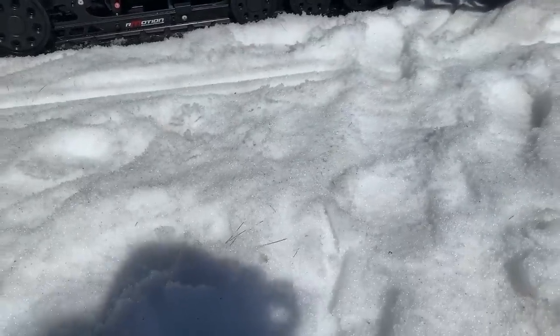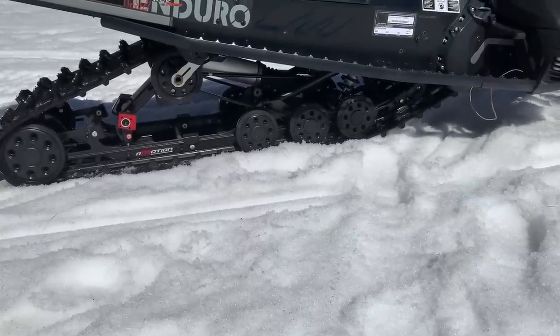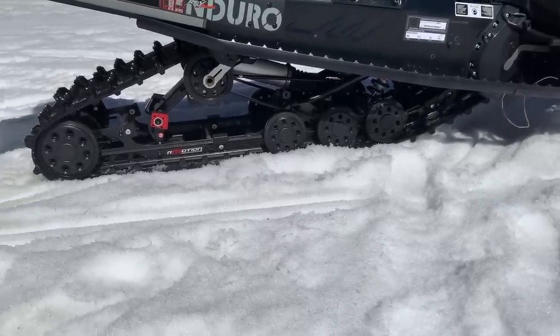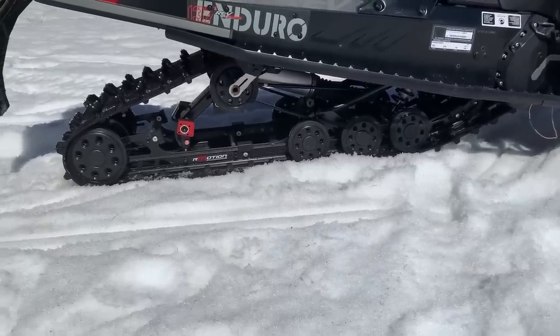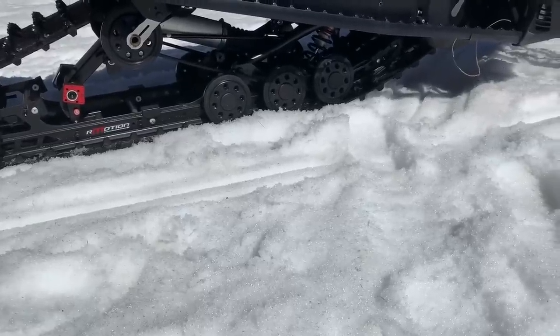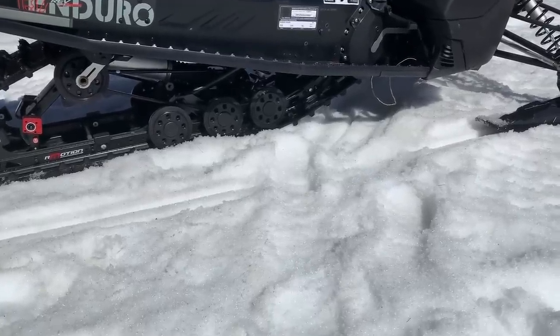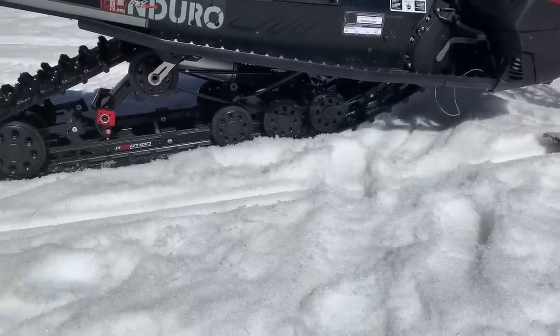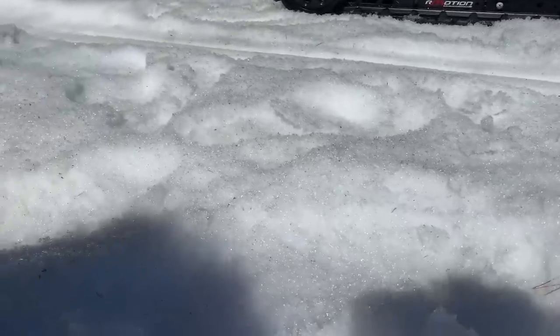We went out for a big ride about three weeks ago, switched around sleds quite a bit, and everybody had the same opinion - the rear was doing the job it was supposed to, but the front arm shock felt like it was maybe just a little bit sagged out. 4,000k on a shock is a lot of riding, especially a non-adjustable standard shock.